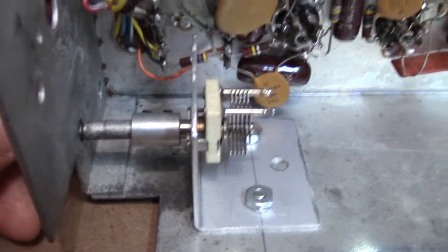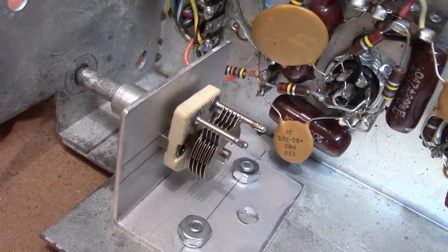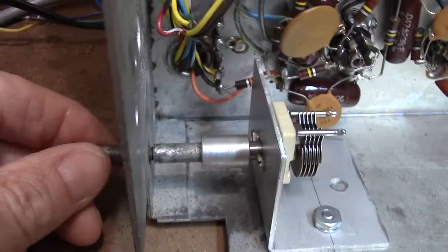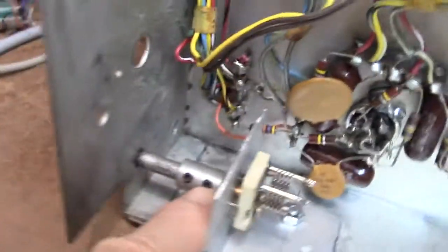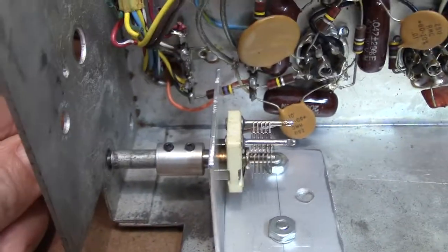This is where the antenna trimmer used to mount right there. I removed the antenna trimmer and mounted it down here on the front corner. To do that I had to make a little L-shaped bracket — three inches by two inches, folded in the middle using a vice or a metal brake. There's a coupling with set screws and I used the original shaft, leaving the clip on the front end. You don't have to put the clip on the back end because the coupling will hold it to the trimmer and the shaft won't move.